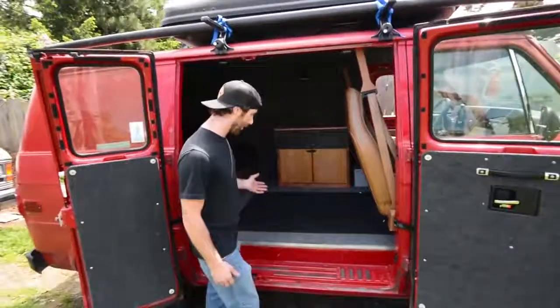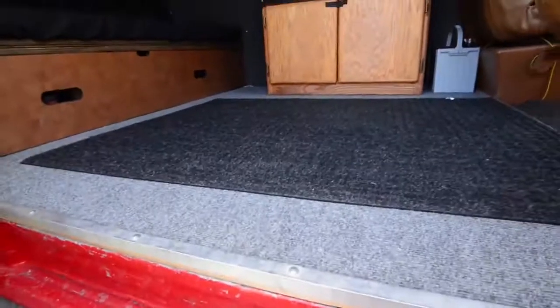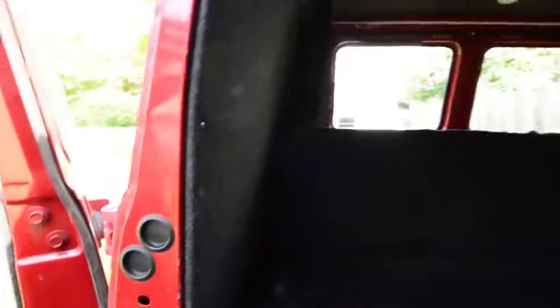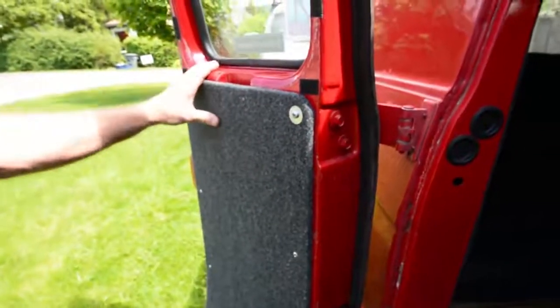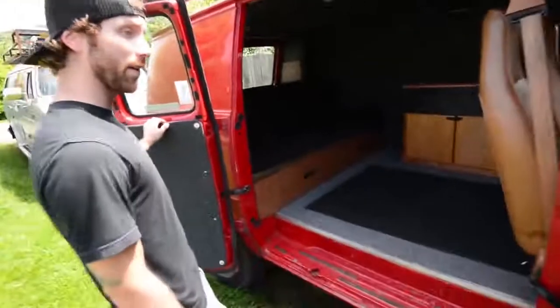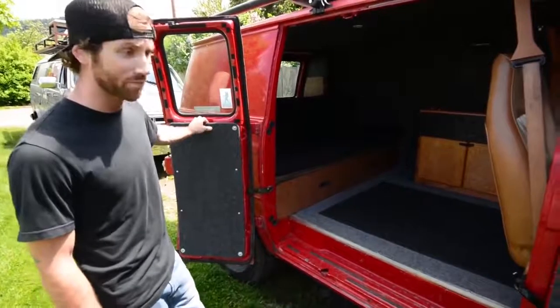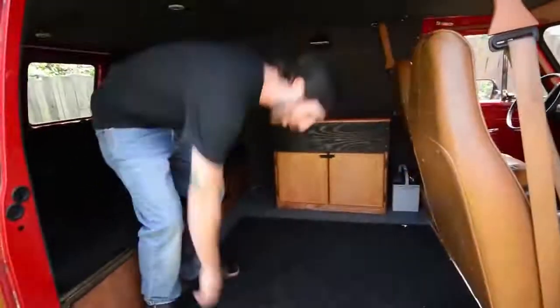The interior I did all myself. It was originally just stock metal, which is great because that's kind of the plan I wanted. I insulated all the walls, the floors, and the doors before putting up the quarter-inch side panels. All the panels have this nice warm felt on them, which turned out really well — I just cut the panels to fit, spray-adhesived the felt on, and screwed them in. It took about an afternoon.